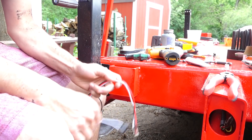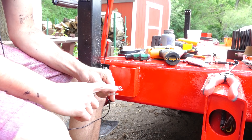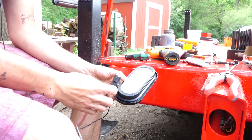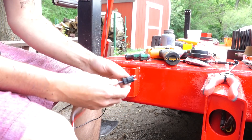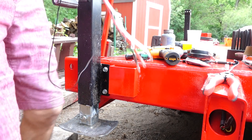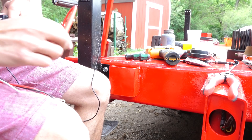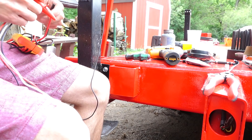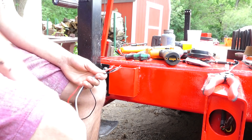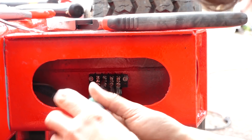So I have the wiring harnesses prepped for the side marker as well as the rear marker turn signal. And I'm trying to figure out which lead on here is the marker and which one is the turn signal. On here it tells me this one down here is supposed to be the turn signal, which should be the bottom prong here. But I have no idea which wire that actually is. So I can use a continuity tester to figure out which one that is real quick, and then we can get these wire harnesses into the terminal block. Red — red is turn signal. So now I gotta see which color on my wire is the right turn signal since we're on the right side of the trailer. The green wire in here is going to be my turn signal — I'll do that one first since it's the easiest.